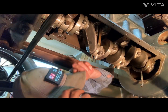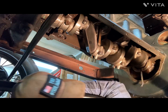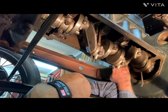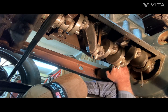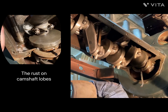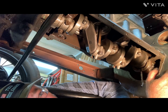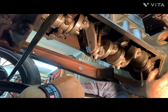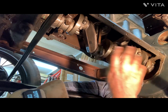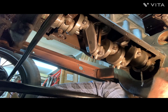About done with the scrubbing on the bottom part here, getting the surface rust off using a scouring pad and some sandpaper on the aggressive spots. There's a problem back here on the cams — the rear cylinder intake has a few bad spots, and this last lobe is pretty rough. I sanded it down and buffed it with the scouring pad, but we'll just have to see how long that camshaft lobe holds up. I think I'm about done scrubbing the surface rust off everything.